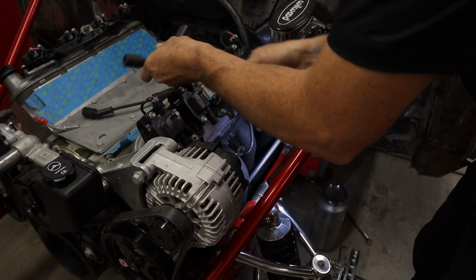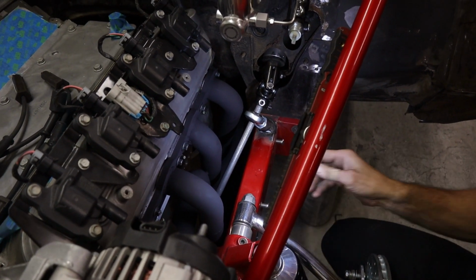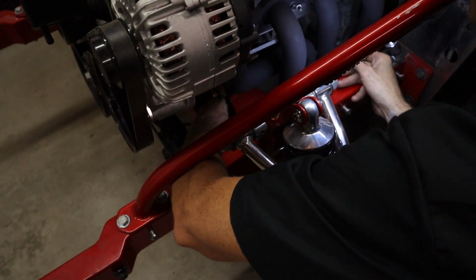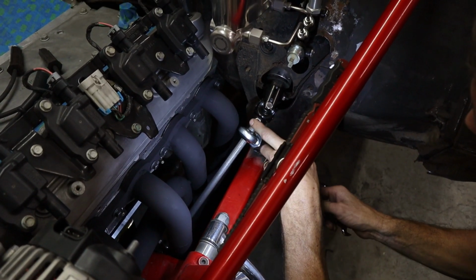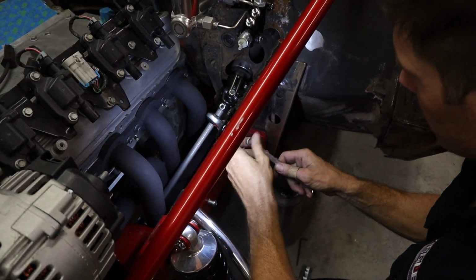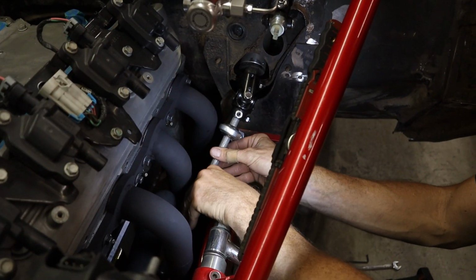And this one here, we got the steering shaft out of the way, so I don't have it all the way tight. What I have set up is a jam nut on the rack itself, so it's just finger tight. So I back up the jam nut, and then the column's not tight, but these are tight. My wrench is very magnetic here on metal shavings, I guess. Take the lock nuts loose and back out the Allen. Push this all the way down.